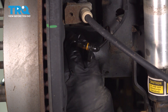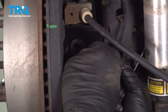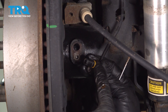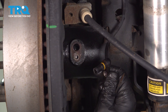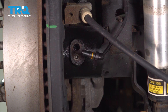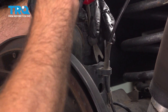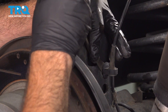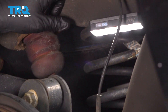Use a towel to clean off the face of the axle tube. There's a little o-ring on this sensor that seals it and keeps any moisture from getting in and keeps the oil from coming out. Now if you follow the sensor up, there is a plastic retainer right here — we're going to use our trim tool to get behind there and pop that out. Follow up to the next retainer up top.